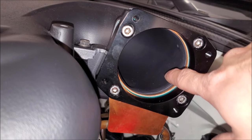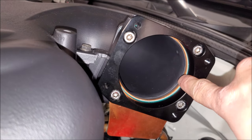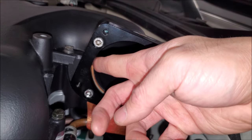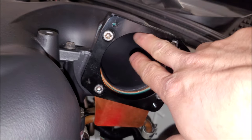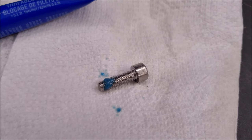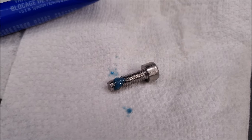What's interesting here is because I already beveled the intake — if you look at our intake video — it actually lines up, and over here it's a bit reduced in diameter, which I'm fine with because the air is going to hit that back wall more than anything. So looking at this is what it's going to look like if you have the same setup. I also recommend a little bit of blue thread lock on the fasteners that attach the throttle body adapter to the intake manifold.